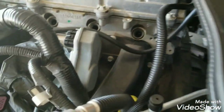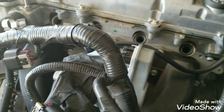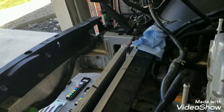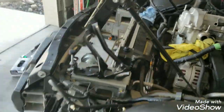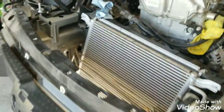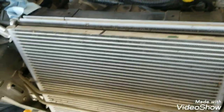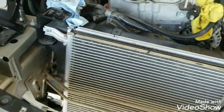There's one, two, three, four, five, six, seven bolts — from what I see there might be one more down there, but there's seven bolts holding that on, so that is next. Coolant hose is off, drained a little bit from there, and I just closed it off with a piece of napkin so nothing else can fall in there. I'm going to drain it out the bottom and then refill it with Amsoil coolant once the time comes.